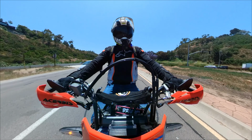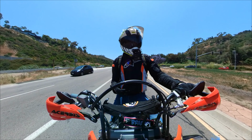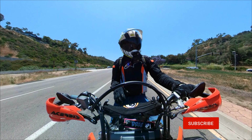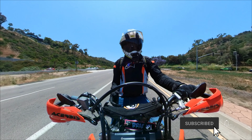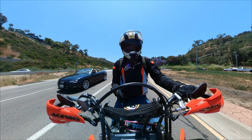We're gonna do dive, hard braking. Wow, it's funny just thinking conceptually in my head that with a softer spring, it would dive more, even though that's more rated for my body weight and my riding style, but it's actually not the case. I feel like it was diving a lot more with the factory suspension with the stiffer spring.